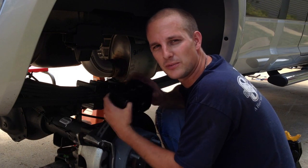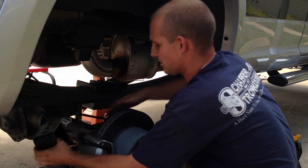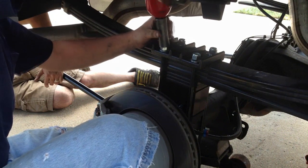You're going to chock the front wheels, get the back of the truck lifted up, take the stock U-bolts out, lower the axle, put your lift blocks in, and then your U-bolts. Now go ahead and tighten up your new U-bolts after you get them in.